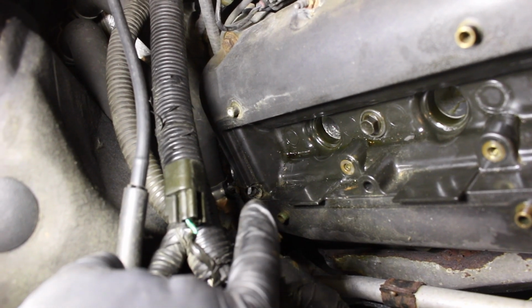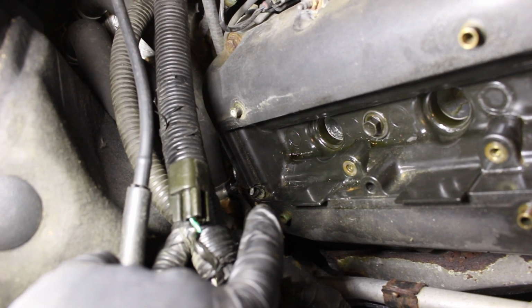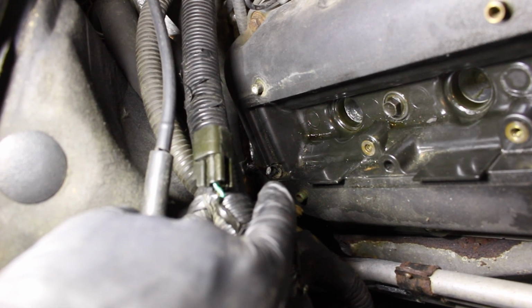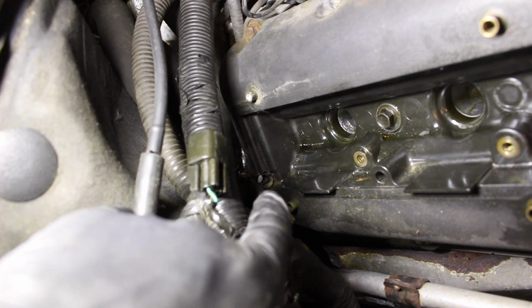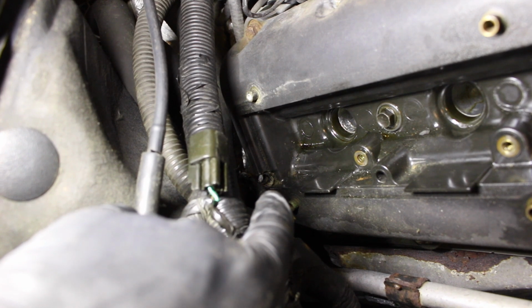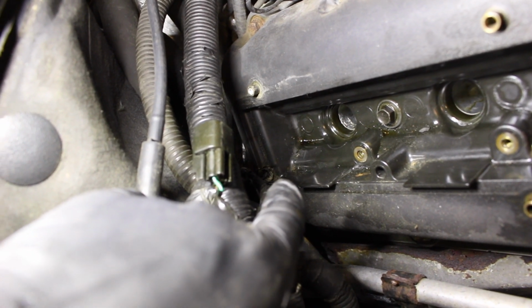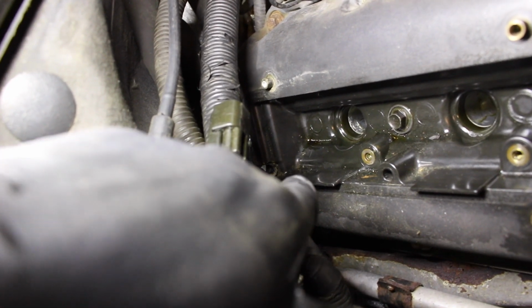The other thing is way back in there, let's see if I can put my finger right there, the spark plug wiring harness goes through there. On this car, it was just held in with some, what is that weird stuff called? Gasket maker stuff. I don't think that's normal, but that's what it was held in with. Just so you know, that's back there. I'm sure there's more things that it's connected to back here, or the wiring harnesses. But I'll tell you as I go along.